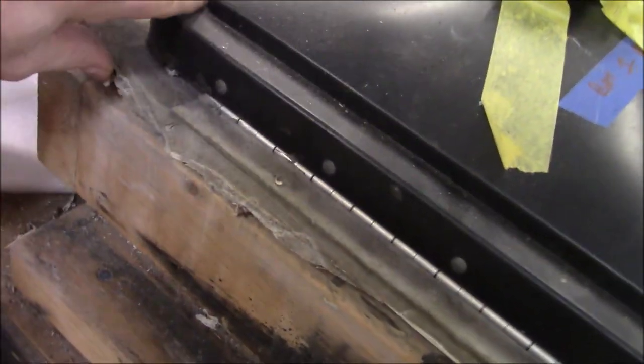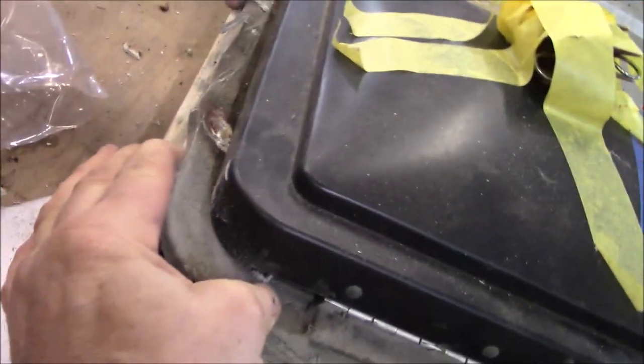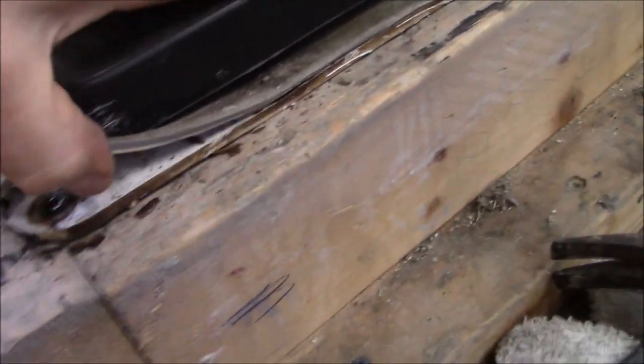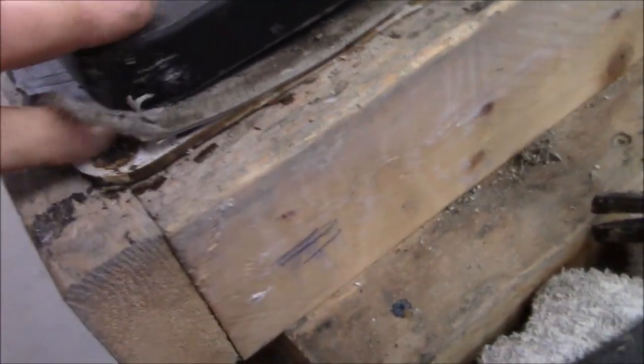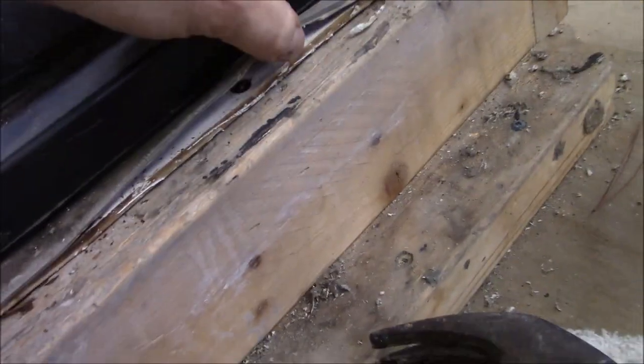This is the vent we're going to clean down. This is your spray-on — see how it doesn't stick? I like to show people this because they say 'I think I'm gonna get a spray-on.' Look — the whole thing's loose. It is not going to stick to that plastic. It'll pop right off, and that's where the leaks are coming from.